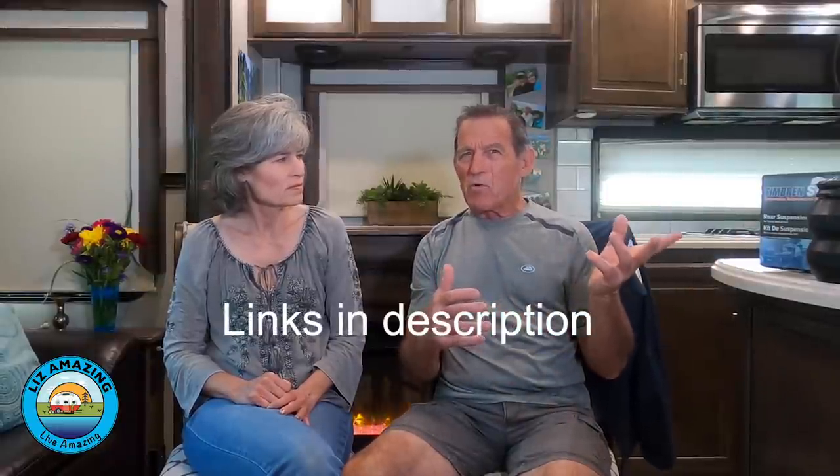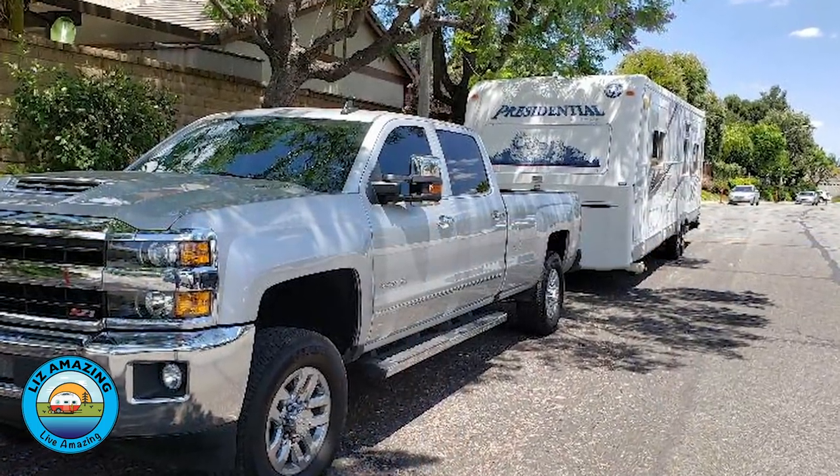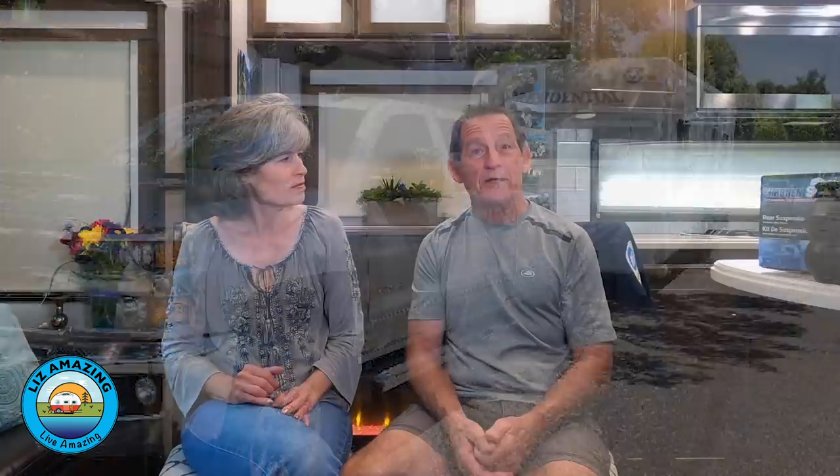Keep in mind this really does not replace your leaf springs — these are made to work in concert with your existing suspension. I'm thinking that everybody should have those, even if you have a one ton. There is a higher-capacity Timbren for the one ton; they're about $100 more, so $325 instead of $225. A good friend, Jerry, put these on his one ton that he just picked up — he pulls an over-30-foot bumper pull — and he said it helps tremendously.